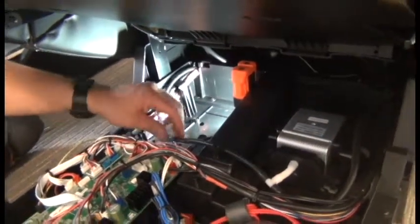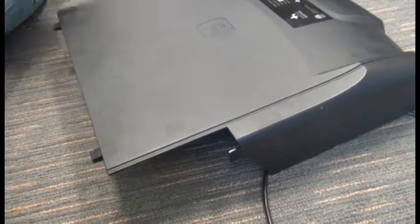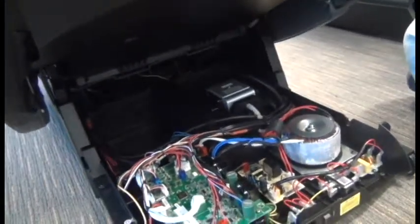And once all the cables are connected, make sure each one is completely seated. Now we're ready to reinstall the rear plastic shroud. You'll note there's a tab here and a tab here. And on the chair, there's a slot here and a slot here. So those tabs need to go into those slots on both sides.